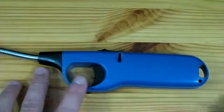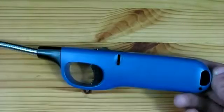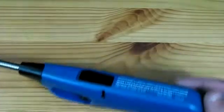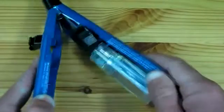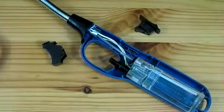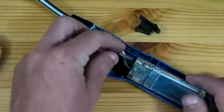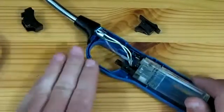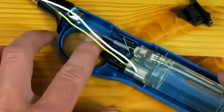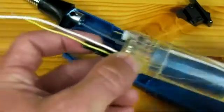The lighter should now be disassembled by removing any screws and cutting along the safety sticker. The body of the lighter should now easily split down the middle, though the front may need to be broken. At this point, the gas line and wires will now be exposed. The gas line can be disconnected, and the wires should be pulled out from the front of the lighter. Now with the gas line disconnected and the wires pulled from the front of the lighter, you can extract this gas chamber.